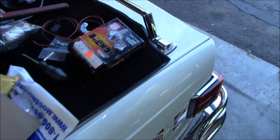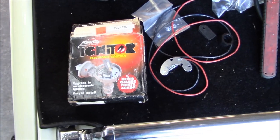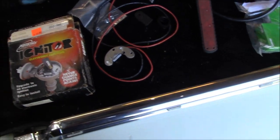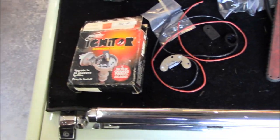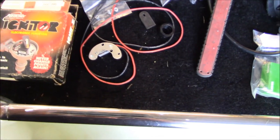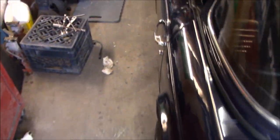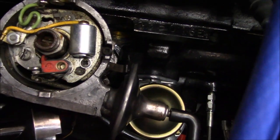My backup Pertronix parts are here. The Pertronix module I bought for the TR250 is actually not the right one - it's for a Mallory distributor. Now I've got the Lucas distributor in there, so I'm using my backup Pertronix instead. Again, we've got a full points distributor to carry with us, plus extra sets of points, so it's not a big deal if the Pertronix happens to burn out - I've never had an issue personally, knock on wood. But it's always good to have backups.